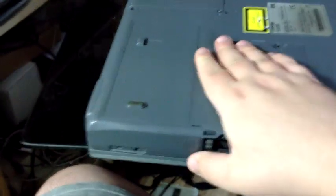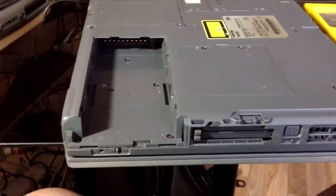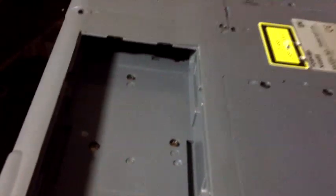When you're working on laptops, remember you do have two power sources: the AC power and, of course, the battery. I know it might seem like I am stating the obvious here, but when you're getting carried away in the moment with upgrades, you might forget to remove the battery. In this case, it's necessary to perform the upgrade because some of the screws to remove the top cover are actually located under the battery. It is essential that if you're working on anything electrical, you remove the battery first and disconnect from all power sources.